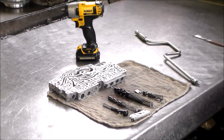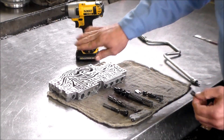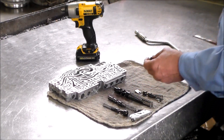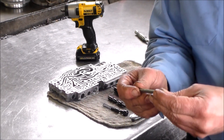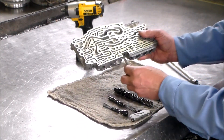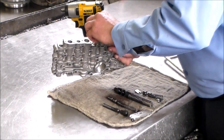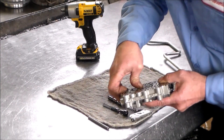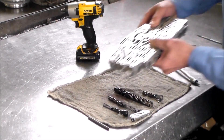For this section here — they call this the lube valve. It's like a floating valve. You've got to get it all the way up into the valve bore, all the way up. Sometimes with a cocked bore or whatever, it might be a little bit of a pain to get in. What I do is I have this piece of tubing — it's probably like 5/16 cooler line — and this fits perfect right in there to hold it. I just feed it right up, turn it upside down, it's in. We're going to put the clip in — remember the long side faces back. And that's in and free.